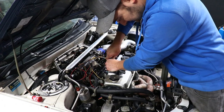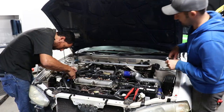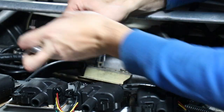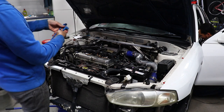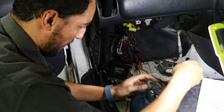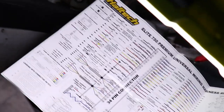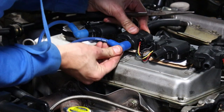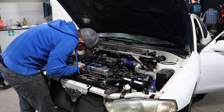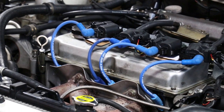All that's left to do is bolt the coils down tight and terminate the wiring with plugs that come included with the new coils. It's possible to buy these brand new with everything required, but if you get them second hand, make sure you get the loom and plugs from the donor engine. We then supply the coils with a ground, 12 volts, and an individual trigger directly from the ECU. Tell the tuning software you've now got individual coil packs, and the car will start and run better than before — but you'll need a full retune to take advantage of the extra ignition power now available.